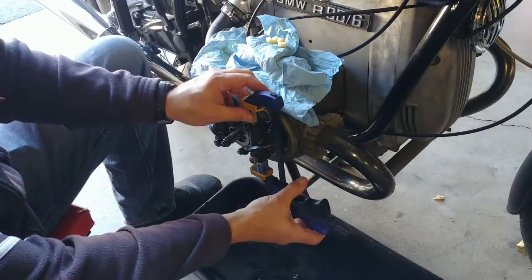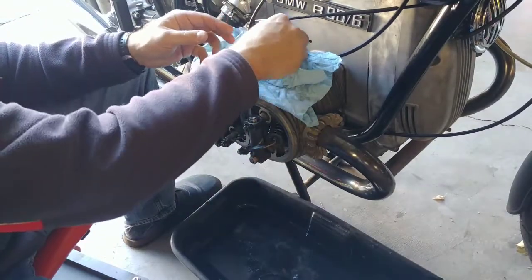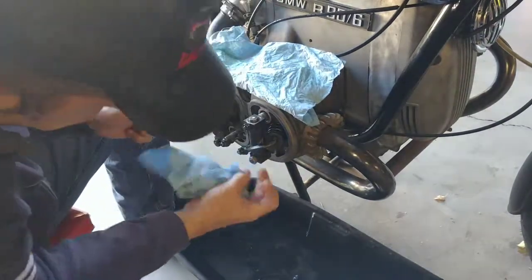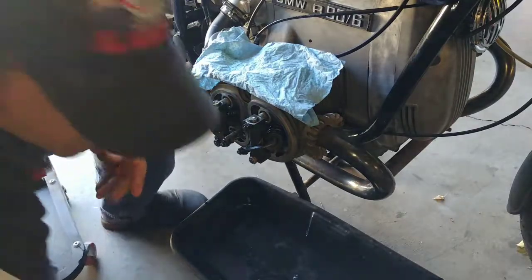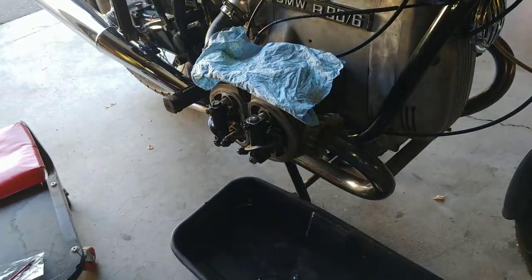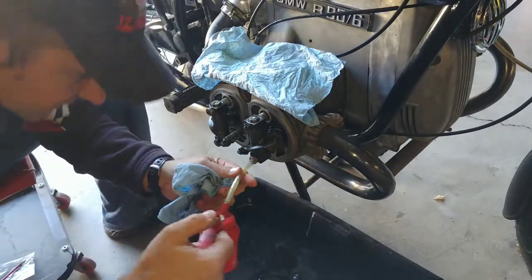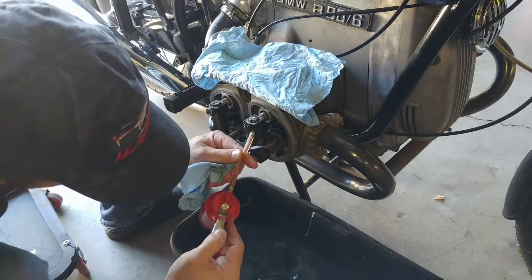All right, now I take my clamp off with my two nuts, not sockets. Take this off, make sure we don't have any grime, gunk, dirt. That feels pretty good. And now I'll get some oil. What I have in this little oil can from Harbor Freight is Marvel Mystery Oil. It doesn't hurt anything. Now I'm just gonna put a drop on each end.